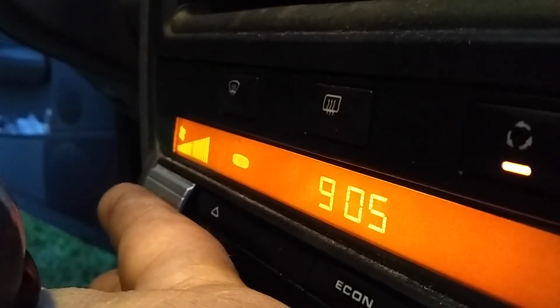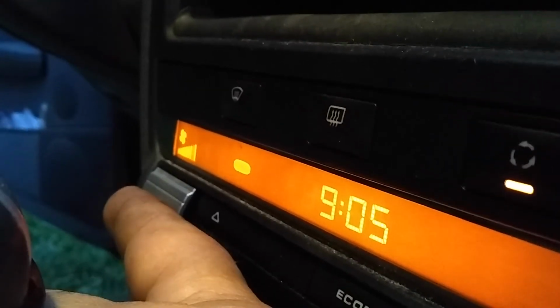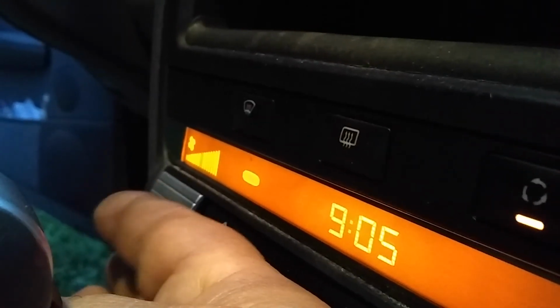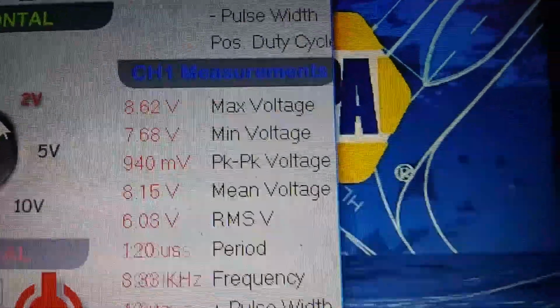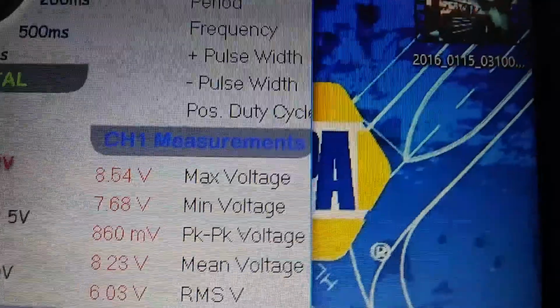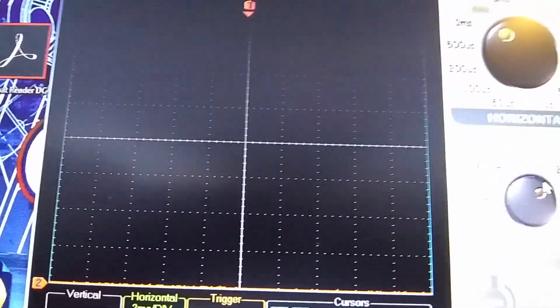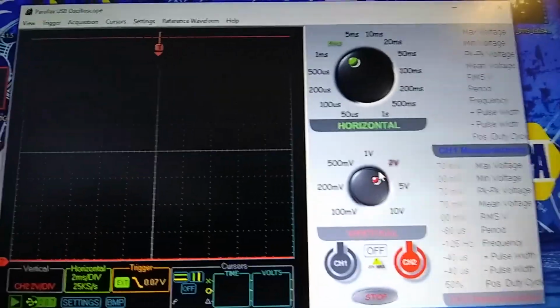And again, I'll show you over here. If we start to kick this down, there's notch, notch, notch, notch, notch, notch. There, it changes. There's a little change there, hardly any change on these last settings. And there's no voltage change on those last settings. And there finally is a voltage change. But when we turn it off and let that thing cool, and that controller cool, then it'll come on full blast and start pumping out nearly 12 volts. My scope will only read 10 without an attenuator. But we know that the voltage is dropping.